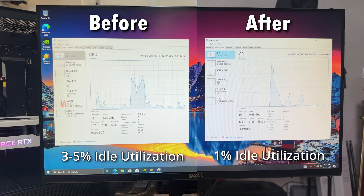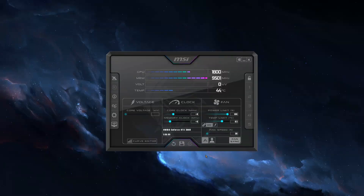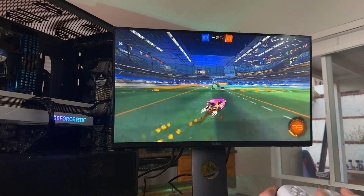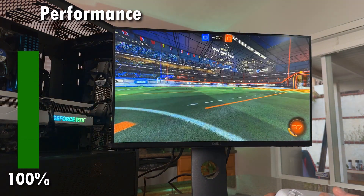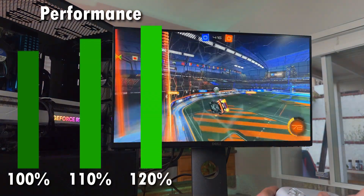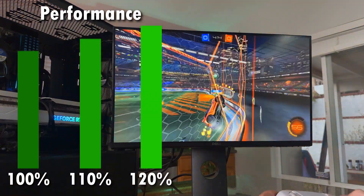Now let's talk about your GPU's performance. There are two programs — MSI Afterburner and EVGA Precision X1 — each of which essentially do the same things but with their own flavors and use cases. I'm going to be talking about MSI Afterburner. It's an incredible tool that allows you to tweak your GPU clock speeds, voltages, power limits, and more. What we're here for is the power limit. When you're playing a game, your GPU will go as hard as it can up until the 100% power limit. However, if you raise this limit to 105, 110, or even 120% of the maximum, that'll allow your GPU to boost higher and for longer, giving you more FPS.